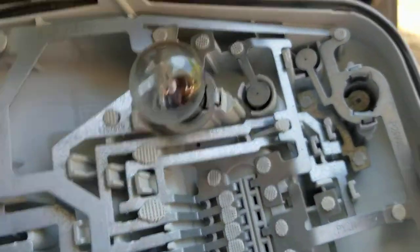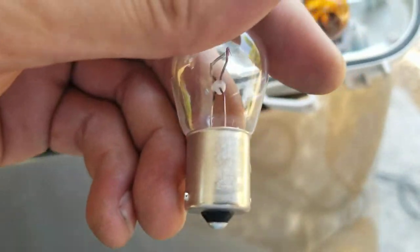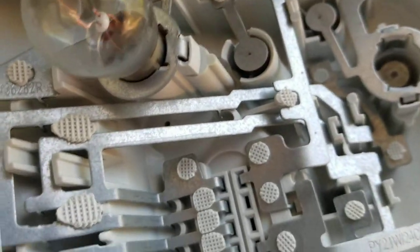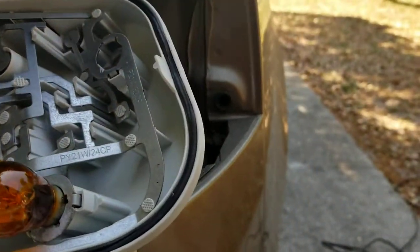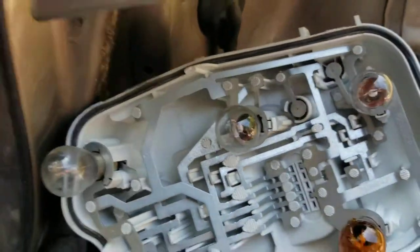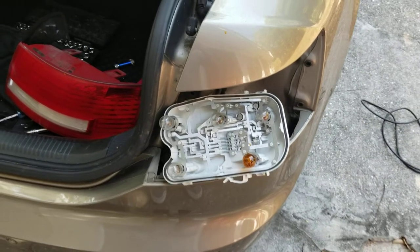All right, you can see I've got my trim back on. The bulb is a 7506. If you look inside the housing you'll see where the bulb goes — you've got to kind of put it in and give it a nice turn. With a slight push it's kind of spring loaded. Now just put the housing back on, throw everything back together, and reverse what I just did.